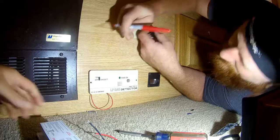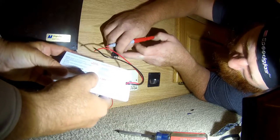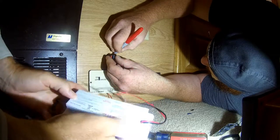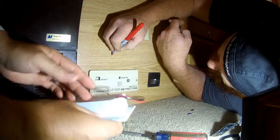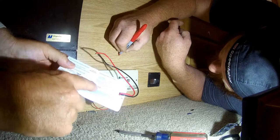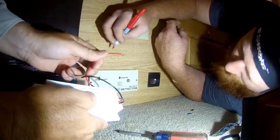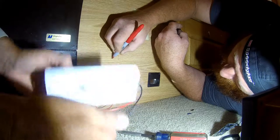While he's doing that, I don't know if this will focus because I can't see, but there's a date here, April 24th, 2017. These expire. They have an internal clock at 5 years. They start getting a red green flash, but it's from when it's powered up. So if you're at the store and you start looking at the dates, don't worry about it. It's not like an expiration date until it's hot. As soon as it gets power is when the clock starts.